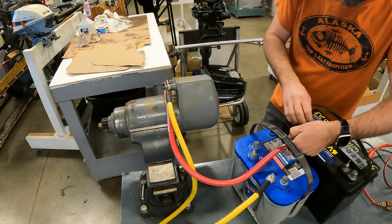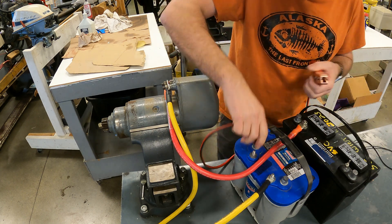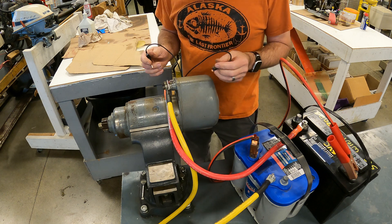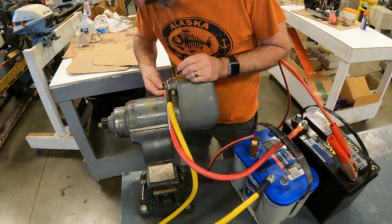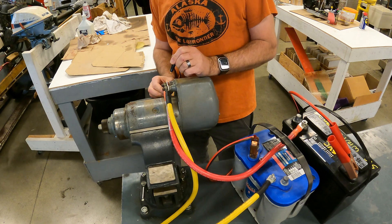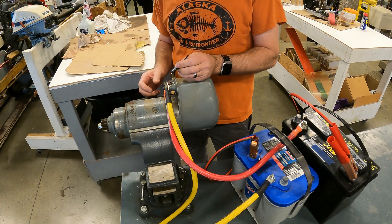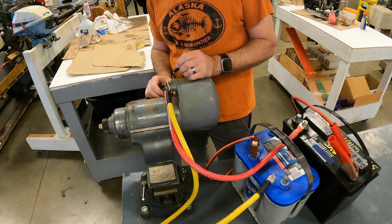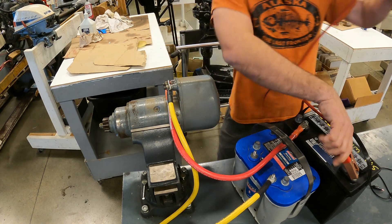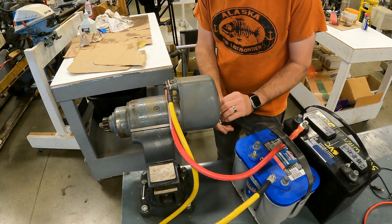We make a positive-to-negative connection — I would not start the engine with this small wire, but for testing the starter I think it's fine. Let's see how it works with 24 volts. With the little jumper wire on, we go for it — hey, there we go! It actually engages and pops out. Good to know. 24 volts, Sam — that's what we're going to use. Seems nice, smooth, and loud. Beautiful! Other than needing a coat of paint, let's take a look inside and make sure it isn't corroded before we reassemble it on the motor.